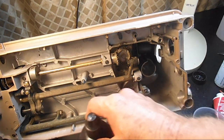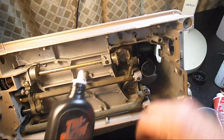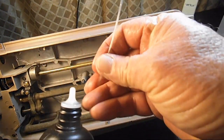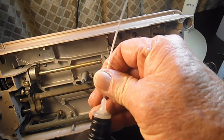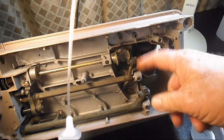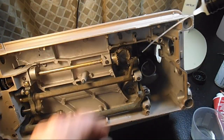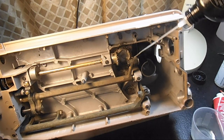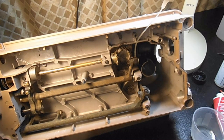I'll put a link to where you can download the free manual for this, and it'll show you all the oil points. Metal on metal is pretty much where you oil it. I like to start with the Tri-Flow in those spots — get that going in there good. I'm going to jam that straw right in that hole. When you're oiling, if you see a little oil hole, that is where to put that straw. The other places are just kind of like bushings — you put oil where the metal touches the metal.